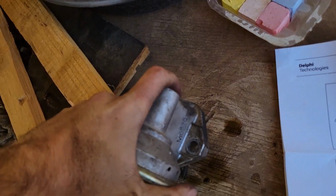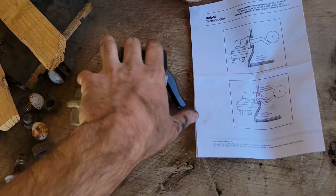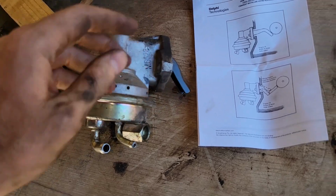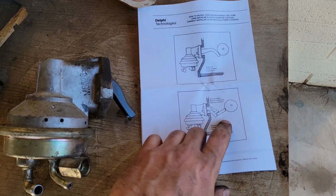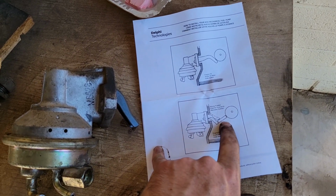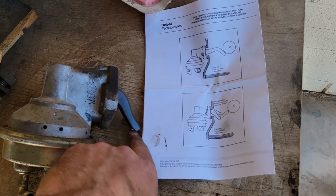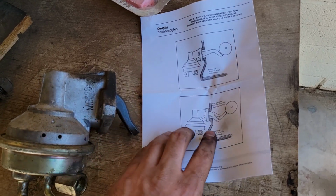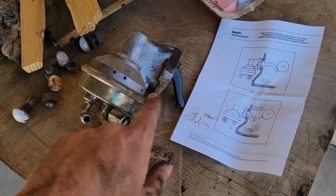which I'm going to have to get my tripod for because it's harder than it looks. So let me go ahead and try and get my tripod so I can show you that action. But again, this will be helpful too with installation, just because this specific engine, this 350 small block, does have this rod, and so you need to make sure that the rod is on top of the new one instead of this being on top of it, because otherwise it'll cause damage and it won't work properly. So let me go ahead and get a tripod just so I can show you this.